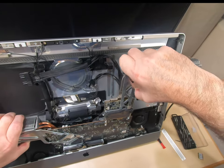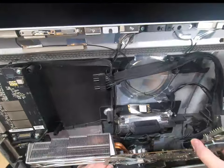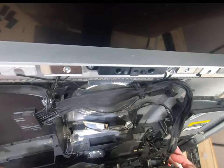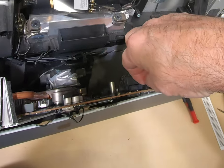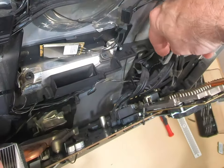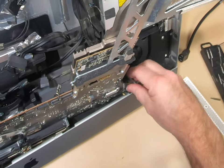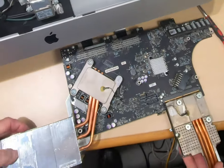Let's set it back up and see if we can get the board out. This little sensor switch always gets stuck on these. I don't like to take them out if I don't have to. Back here we've got some power cables we have to take off — pull that one up, pull it out. There's a little sensor cable of some sort. Another cable here that I think goes up here for power. We've got power there and a SATA. And there it is — folks, it's not simple, but it's not impossible.